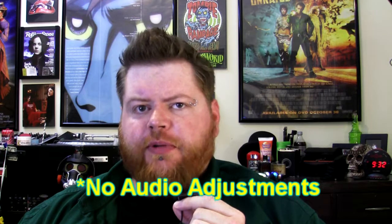This right here is the Audio-Technica ATR-3350IS. The difference between this and some of their other lav microphones is the 'IS' — it has an adapter so you can plug this into your iPhone, and then plug a headset into one side of the adapter to hear your audio as you're recording. You can pick this up for about thirty-five dollars. The audio is very clear; I didn't have any peaking. The sound is very rich, more full, and very crisp. As long as your audio interface is fine, you won't have to do any post work on your audio with the Audio-Technica microphone.